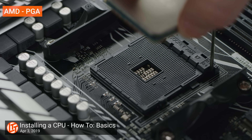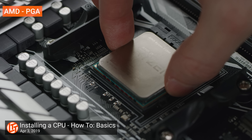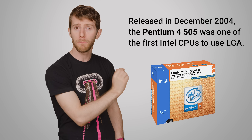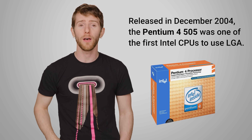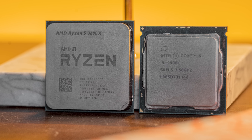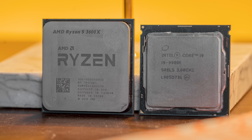Another advantage you can more readily experience firsthand when building or upgrading your own PC is that PGA chips tend to be a bit easier to install, since there are no super delicate motherboard pins to worry about — though you do have to make sure you hit every hole in the socket properly. These advantages have led AMD to keep using PGA for its consumer-level chips, even long after Intel abandoned pins on their desktop chips way back in 2004. And even though current third-gen Ryzen processors actually have more contacts on the bottom than their Intel rivals, AMD still found a way to fit all those pins onto one package, partly because the processors themselves are physically larger.